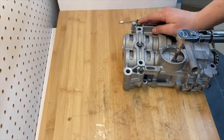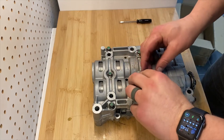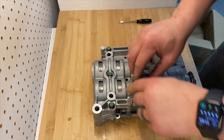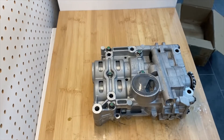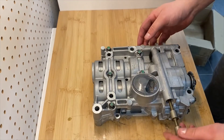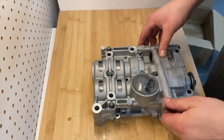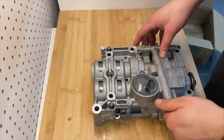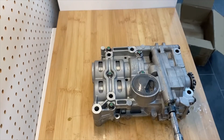I'm going to torque this bolt down. Now we've got to go install our pickup — make sure your marks are all matched up. Tap that into place and make sure it stays nice and tight without damaging it. Install your spring. Don't drop your relief valve, then install your relief valve. Install the plug — that spec is going to be 15 foot-pounds.